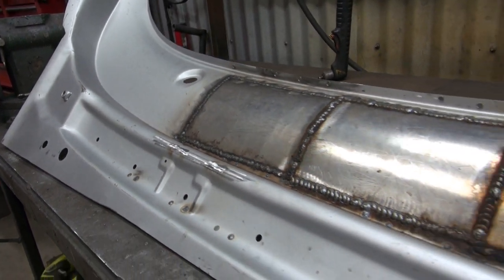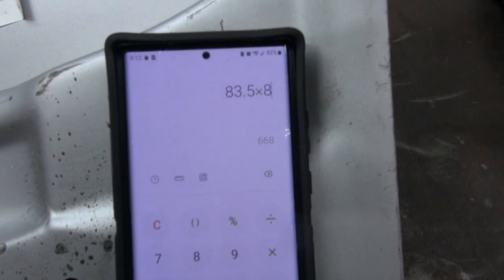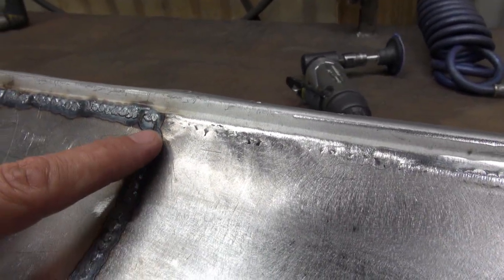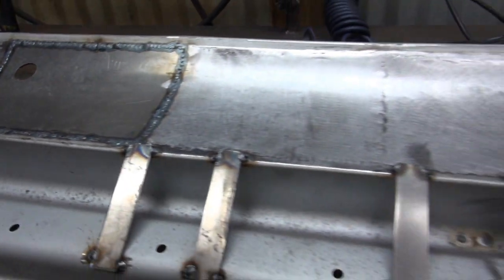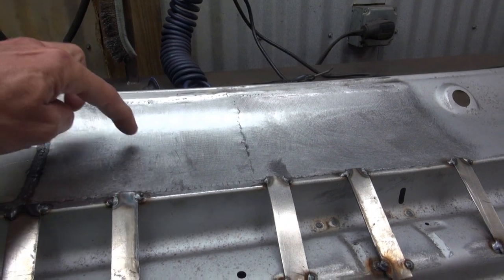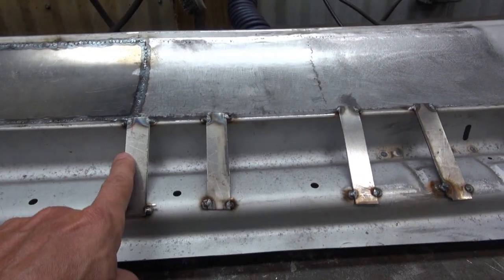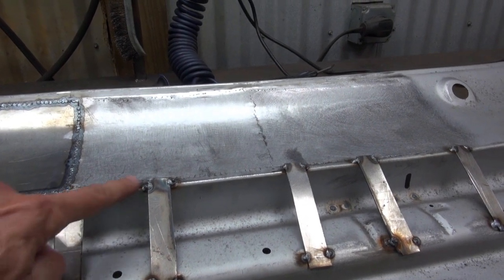Here is the backside of the cowl with all four patch panels in place. I'm measuring about 83 and a half inches of actual welds and roughly eight welds per inch — I think I've done about 668 welds on this thing. This is what the top side of the cowl looks like — all of my little welds have not yet been dressed and ground down. I'll be using a sanding disc with about 60 grit to knock those welds down. I also want to mention the braces I added — I did that so I could hammer and dolly on this area and push it down to create a little more curvature without drawing the seam and pulling it and changing the body line of the car. I welded in some temporary braces I'm about to cut out and grind down. It was ultimately about strengthening this edge so it did not move.